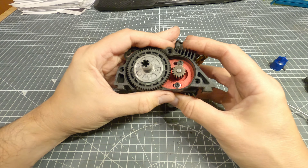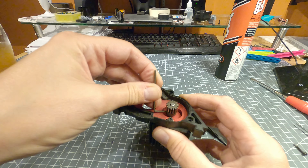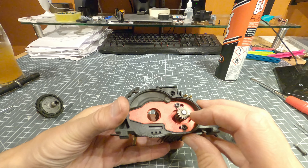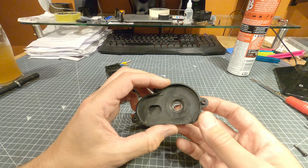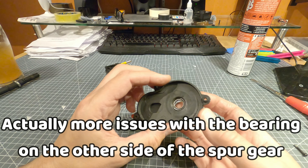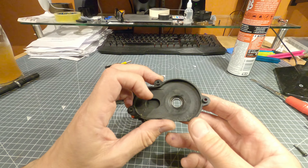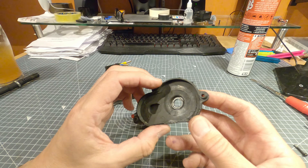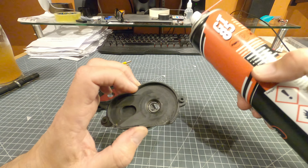Got that loose there to get the mesh back where it should be. I've got the 15-tooth pinion on here — I just wanted quicker acceleration. With the 20-tooth pinion, when you undo these to get the motor out, the pinion doesn't actually fit through the hole in the back, so you've got to use an L-shaped allen key to get the pinion off first. And if you've got the one with the e-clip, you have to get the e-clip off with a little screwdriver.